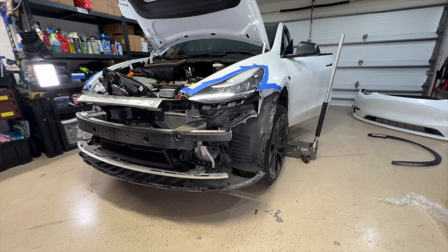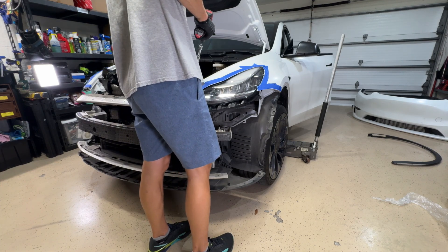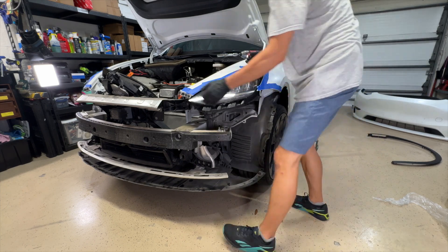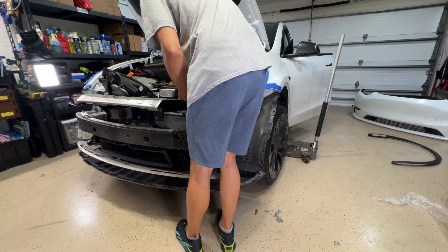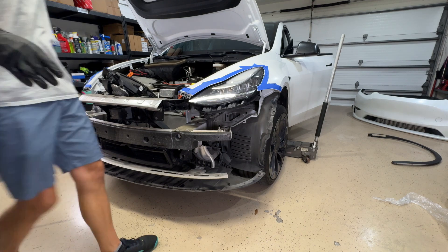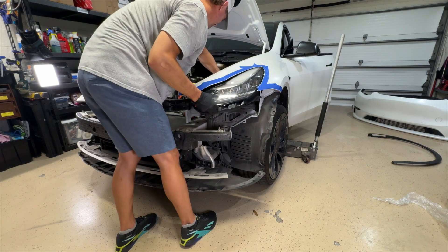There's like a collar that it goes into inside of the fender and it must not have been there. The car was wrapped, so maybe they removed the headlight and when they did they didn't put it back in correctly. Now I'm working on getting the other headlight out — just the two 10 millimeter screws on both sides. As you can see, I pointed to the top saying it's still secured, so both the bolts are out and it hasn't fallen down like it did on the other side.